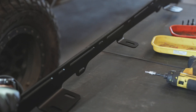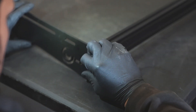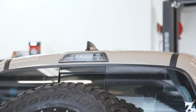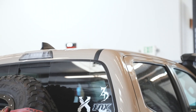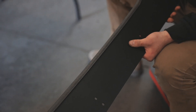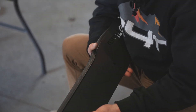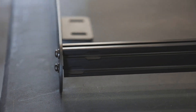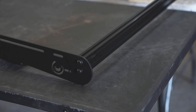So this is the driver's side side plate. What we are doing here is we are installing the very back load bar. The reason we are installing it vertically is so that way, when you put it on the roof, it will actually clear that black antenna. If you put it the other way, it will not clear and it will make contact, so don't do that. Another thing is that these three feet on the rack will coordinate with the factory holes that are already existing on the actual roof itself. What we are doing now is installing the noise trim reducer, which is optional. But I highly suggest this to pretty much everybody just because it's going to save you a lot of headache from the wind noise you can get with the front wind fairing. One thing to note when installing load bars is these drop-in points — these allow you to put a bolt in there to install any accessories or lights, so make sure they are faced out or up.